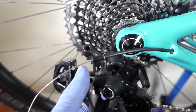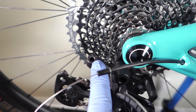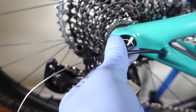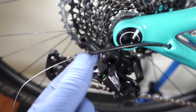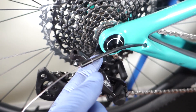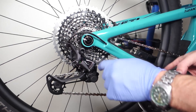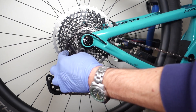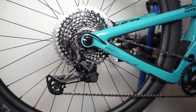Because of the way cable housing ends right here on the derailleur, just keep in mind that on the Shimano derailleurs you're gonna need a slightly longer hose. As you can see on this one, I need to pull it out of the frame a little bit more because otherwise it won't fit. If you have any derailleur other than the SX, you're gonna need to make sure you can accommodate that — so longer housing. The clutch is engaged because you cannot really disengage it on a SRAM derailleur, and I have the B-gap adjusted as per Shimano recommendation, so I didn't use the SRAM tool at all. Let's give this a try!